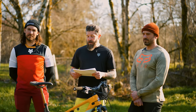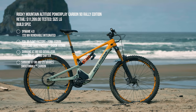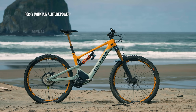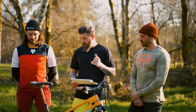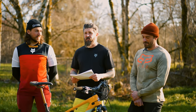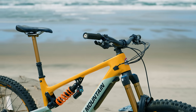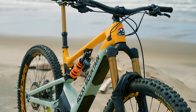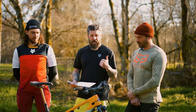Bikes start at $6,199 and go up to the top-of-the-line model here, the C90 Rally Edition, at $11,399. It is a 29-inch-wheeled-only bike with 170 millimeters of travel up front and 160-millimeter rear travel, equipped with a Shimano XT brake and drivetrain system. The rest of the kit is pretty solid, with Race Face ARC 30 wheels, a Fox transfer post, and it comes with Cushcore inserts — which is forward-thinking for this bike's intentions and enhances ride quality, making it quiet and tracking well.